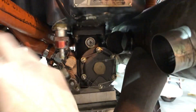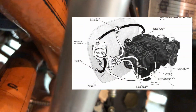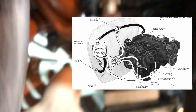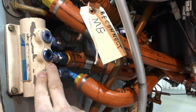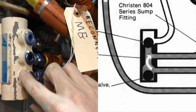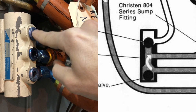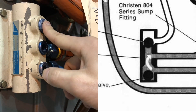Normally what's going on here is we have this hose right here that leads up into the oil pan — it's all the way up in here. That brings unpressurized oil into the first portion of our inverted oil system. Within here we have two ball valves, one at the top and one at the bottom. Right now the one at the bottom is all the way bottomed out and the one at the top is stopped right about here, which blocks off this upper portion, which is part of the inverted system.